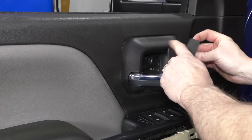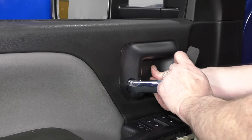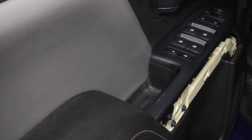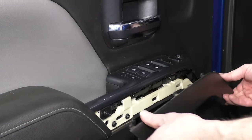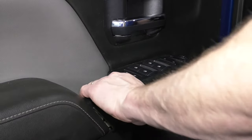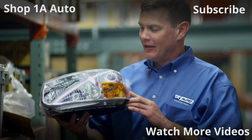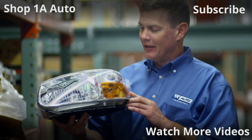Panel's back in — curve the soft corners at the top and push into place. The little notch goes in the front. Then this panel: once you've put your clips back on, put the top up and pull it in and snap it back in place. Thanks for watching — visit 1AAuto.com, your place for DIY auto repairs, for great parts, great service, and more content.